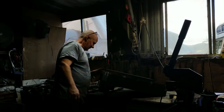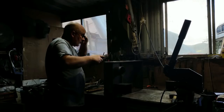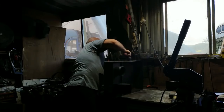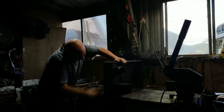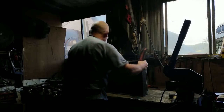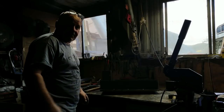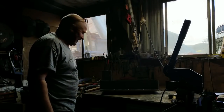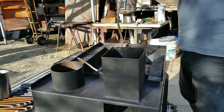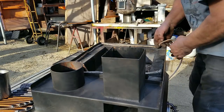I won't bother painting it just yet. We're going to put the thing back together. After fitting the fire bricks back into the box, the next job is to rope with the fiberglass rope around the edge and replace the cook plate.